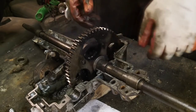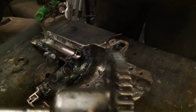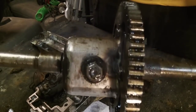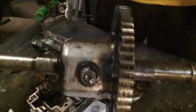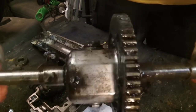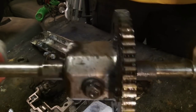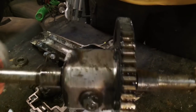Remember all the wobbling that we had before? I'm trying as hard as I can to move it right now. There is just a little bit of play left, and that's because the spider gears on the inside are probably playing around just a little along with the axle. But that is a million times better than what we had before. And as you can see, I cannot rotate it. It is fully locked.